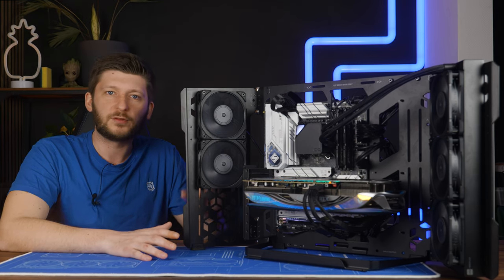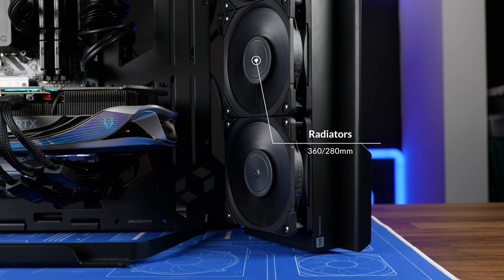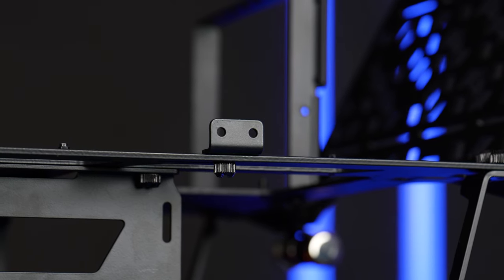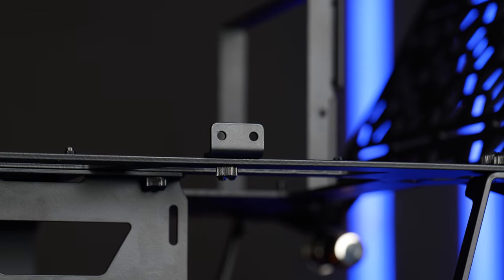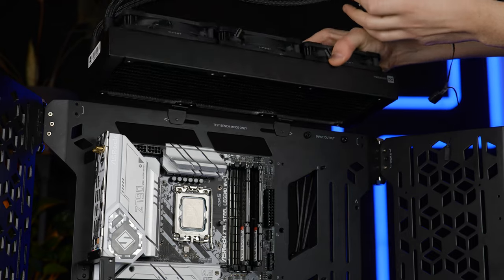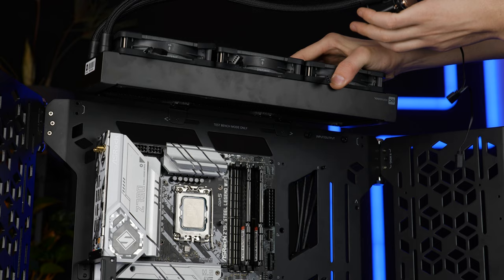Now let's get to the fans. You're meant to use the two wings to mount fans onto them — by spec, either three 120mm or two 140mm fans. For radiators, it's the same: either up to a 360 or a 280. There are also two 90-degree adapters that can support up to a 420mm rad, which can be mounted onto the top of the main plate with the rad either resting on the bracket or hanging from it. Cooler Master says this is only possible in test bench mode, but if you skip the glass, you could also do it while the case is standing upright. However, don't — if the case is standing, the whole radiator would be pulling on it, and you don't want that.